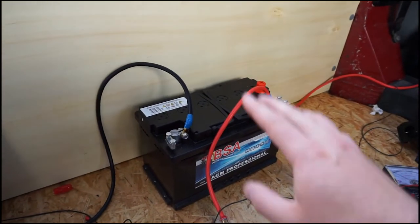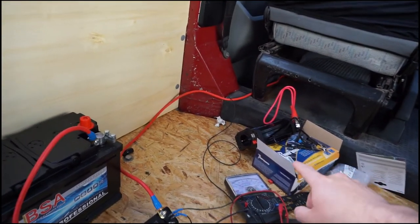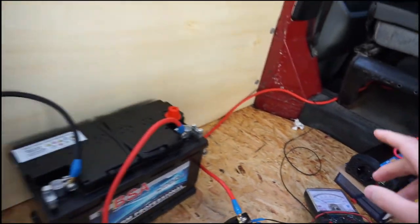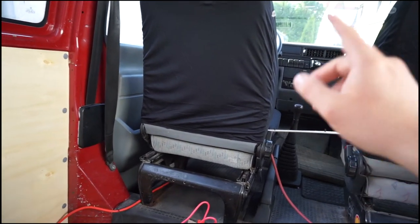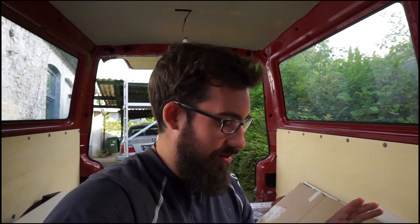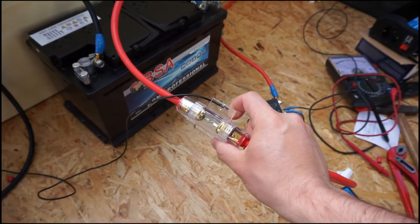If the engine is not running, the batteries are disconnected, so I can charge my phone, laptop, camera batteries, use the lights, and run this power inverter to have a real power plug — and I can discharge this battery basically fully without discharging the starter battery, so I can still start the vehicle even if this is empty. The big problem was finding an actual signal from the engine that tells this relay to connect or not. The pin I used first only had two volts; I found another one that actually has 12 volts, so now it's working.